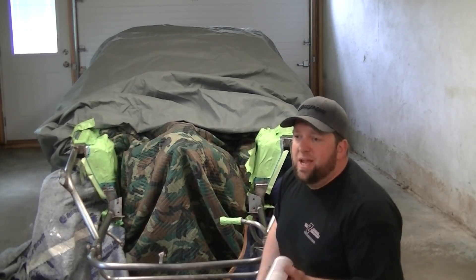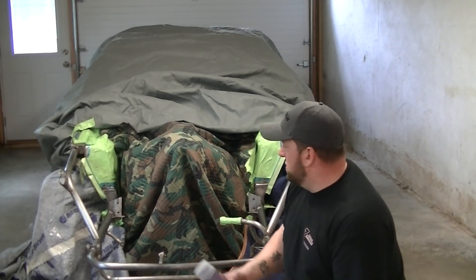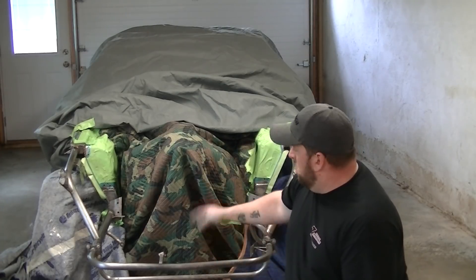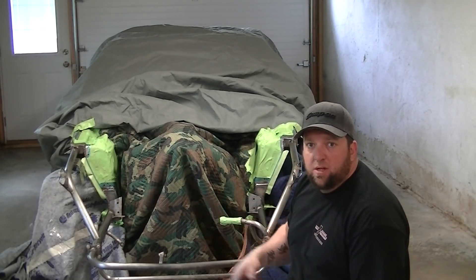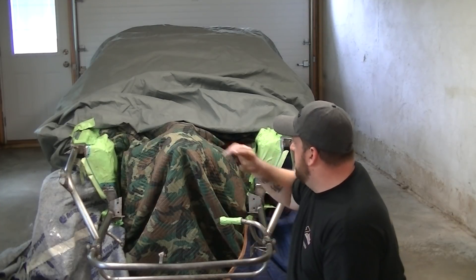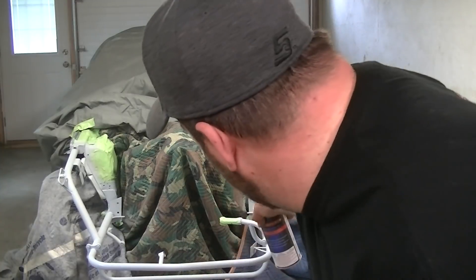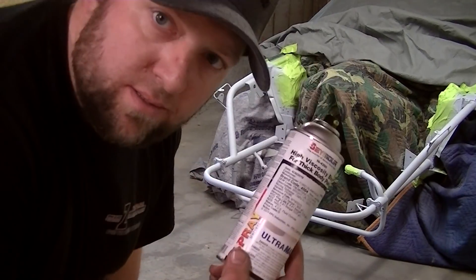It's gonna look like crap if I don't, and I won't even want to bring this car out if the whole front end is rusty. So I'm just gonna splash some paint on it — not going crazy. I got some self-etching primer, I'm gonna prime it, then I have single stage in a can I'm just gonna spray on it and maybe a coat of clear. Already scuffed it, taped it, masked it off, and cleaned it with acetone. There's a little spot with some fish eye — I'll let that dry since it's a little humid today.